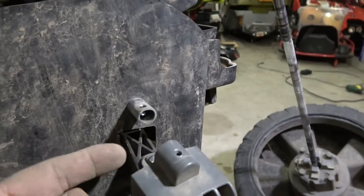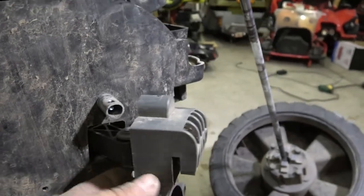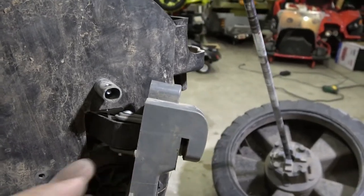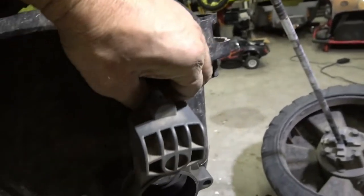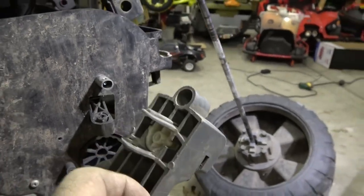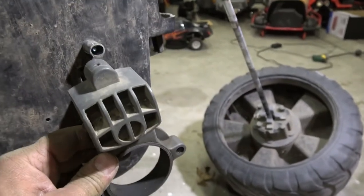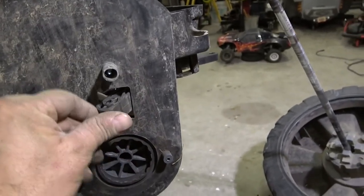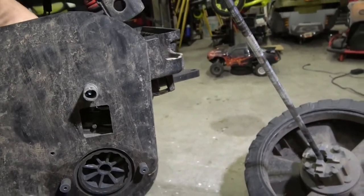This is going back together. Instead of putting it up from the bottom and using the push nut, I'm just putting the pin straight down — it's not going to fall out. Originally it had a push nut and the pin was facing up. To get this off you pull out the pin, and that gives you access to the inner brake pad so you can file or sand it. Then put it back together making sure the little cam lobe is facing to the back. It goes in like that, and when you pull the brake lever it pushes against the brake pad.